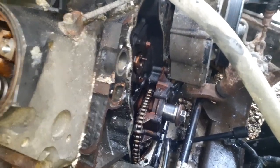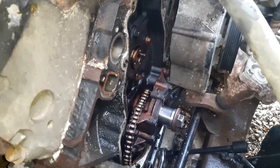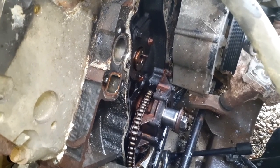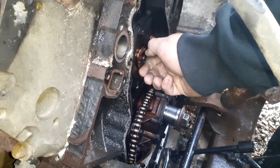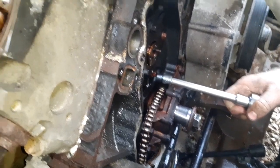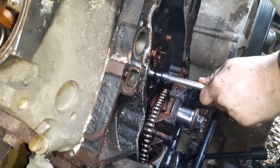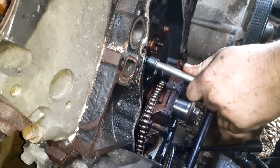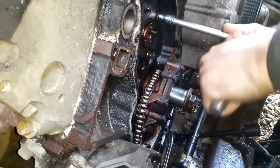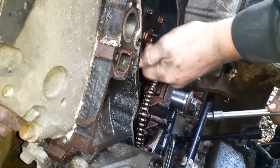So now we took the cam, we lined it up dot to dot. The crank gear at 12 o'clock, the cam gear at 6 o'clock, dot to dot. That crank gear dot is really hard to see if you don't have a lot of light. We're going to take the cam gear back off the dowel pin, bring it down, and take the chain off of it. We're not going to fool with the oil pump - we're going to leave the cam gear, the crank gear the same, not changing the timing set.